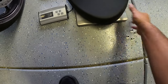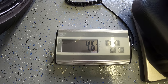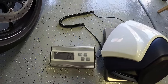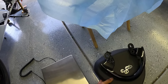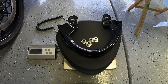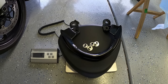Scale is on and zeroed out. We're going to put the seat, grab bar, and spacers on — that's 4.6 pounds. Now let's see how much the rear cowl weighs — the rear cowl is 2.2 pounds. So 4.6 minus 2.2, we saved 2.4 pounds. So we just knocked 9 pounds off this bike — with the rear cowl swap getting rid of the seat, grab handle, and spacers, plus the battery swap. 9 pounds — talk about some easy weight saving.